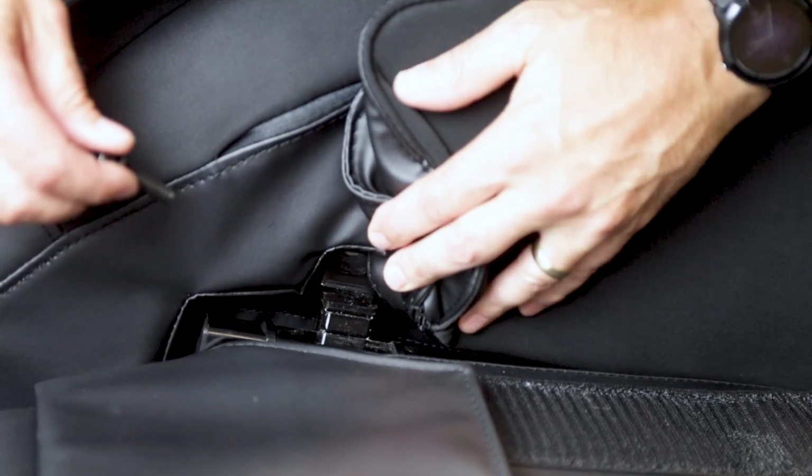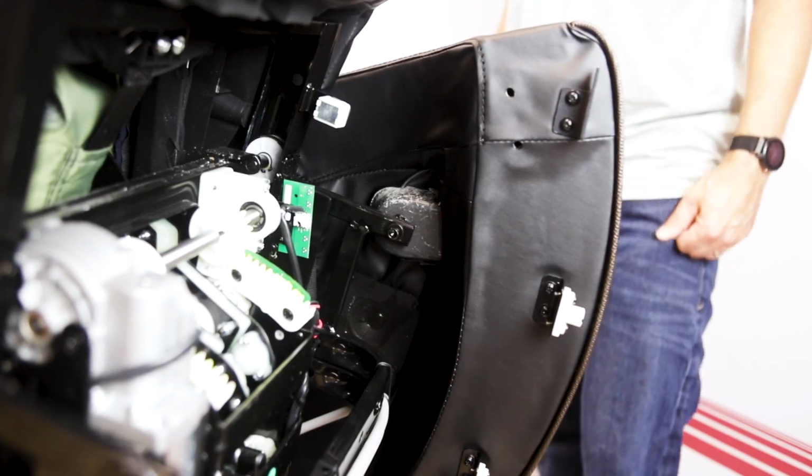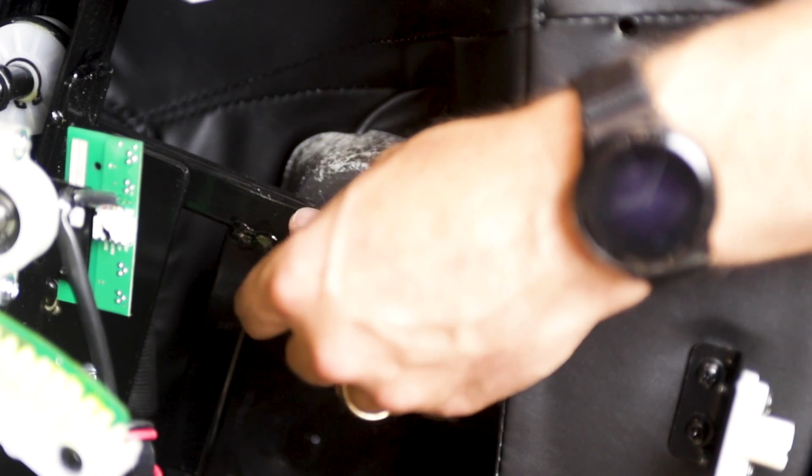Lift the arm up and place the bolt that is toward the middle of the chair onto the cradle that's on the body. Here we're also connecting the hook on the arm that should rest on the frame. While placing the arm of the chair onto the frame, make sure that none of the hoses or electrical connections are pinched. With the arm resting on the frame of the chair, locate the M8 size screws from your hardware box and use them to secure the arms onto the frame through the screw holes that we previously identified.